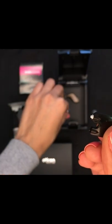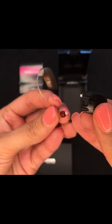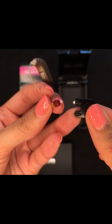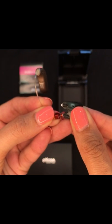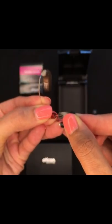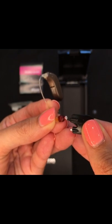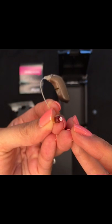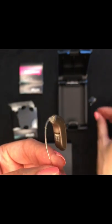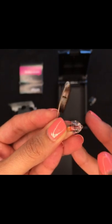So let's grab our device. What we would be doing here is using the empty side with the pin to push into your old filter — it clips, and then you pull it out. Then you push on the new filter and pull out again. To ensure that the filter is securely on, just use your finger to give it a good push, and you have now replaced your filter. This can now be thrown away, and then you would reattach your dome back onto the end of your speaker wire.